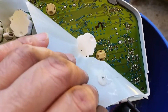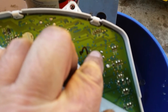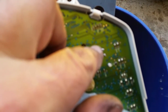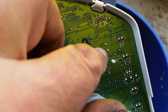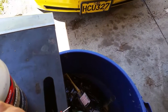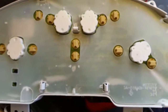We've gotten the cluster out and pulled the plastic covering back on the right side of the back. If you look at the locator pin here, the two points that tend to give people the most trouble are these two right here. I took my soldering iron, got it really hot, and just lightly touched the pin and the solder on both of them until it just started to melt a little bit — to refresh the connection and make sure we had a good tight connection. There's also another set of four little terminals right up under this area; I touched each one of those four too, because someone else said those could go bad. We're going to put this back together now and put it back in the car and see what happens.